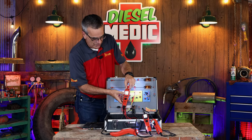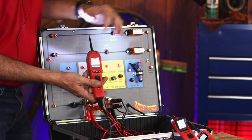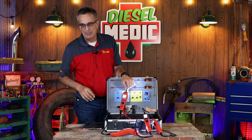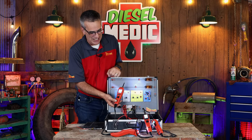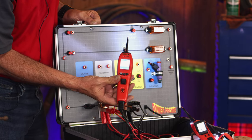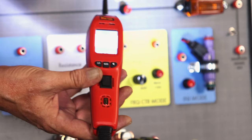That's the modes in the PowerProbe 4. Compared to the 3, it's more like a multimeter packed into your PowerProbe. Some other differences on the 4 you may not be aware of: this is a sealed housing — a lot more water and weatherproof than either of the 3s. I'd get technical support calls from people who work in the marine field on boats. They love using PowerProbes because boats have fiberglass bodies that don't ground, but if they dropped it in the bilge, chances were it wasn't going to survive. This one's a sealed housing — a lot tougher and more weather and dustproof. Also, if you trip the circuit breaker, this one's self-resetting — you just wait a second or two and it'll reset. Unlike the PowerProbe 3, which has a reset tab, these are automatic resetting.